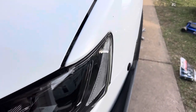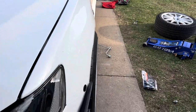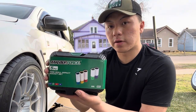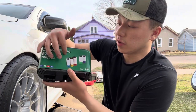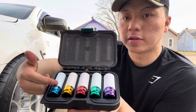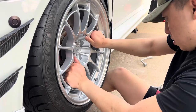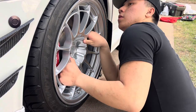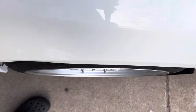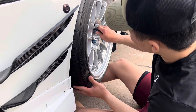Well, this is a little more aggressive than my liking — I like it a little more flush. It's pretty mean so I'm gonna see if I can put the 15mm spacers on instead. I did pick up a set of thin wall impact sockets from Menards. Hopefully these do not scratch up the new wheels because they do have a plastic liner on the outside. We will be using the 17mm. We installed the wheels without spacers and wow, fitment is like mint — whoever told me these need 15mm spacers, you're a damn liar.